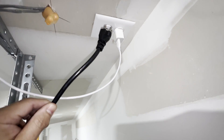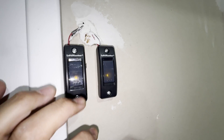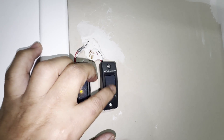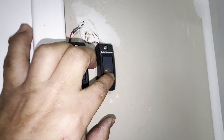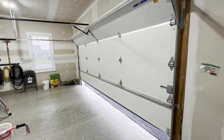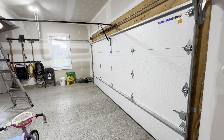I've got the micro-USB plugged into the power. The final thing to do is plug the power back into the garage door opener. First, I want to test that the wall button still works normally — let's open it up. And it does. And close it to make sure it closes properly. That confirms the door will open just with the switch, and even if the ratgdo is not working, it still functions normally.